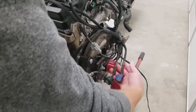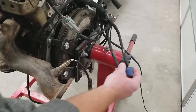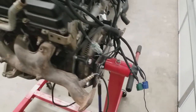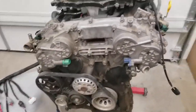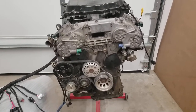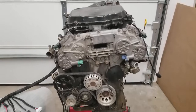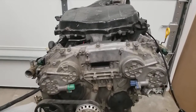If you look back here, the oxygen sensors are also different from bank to bank. This harness in particular is set up to be an early style harness, so oxygen sensors are very important when selecting your harness from us, because the later models came with a six-wire sensor from the factory. So we need to know which style computer you're running, so we can base the harness off that, because the four-wire is not going to work properly with a six-wire computer.